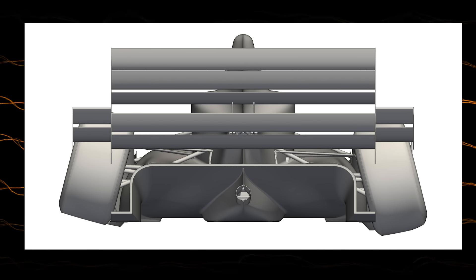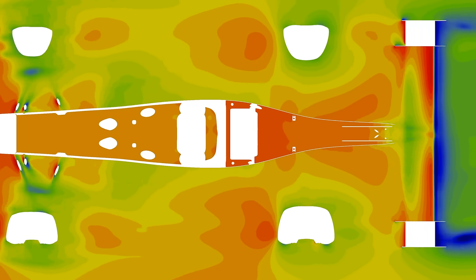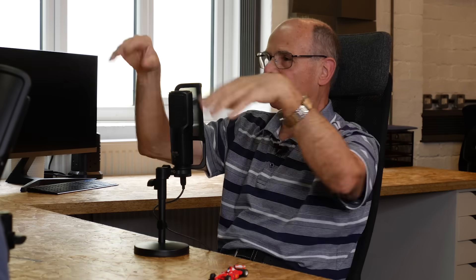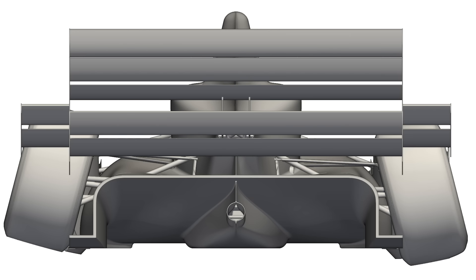Because of the significant changes in ride height, Willem decided to focus on overbody downforce — the wings — as these are less affected by ride height changes. Just look at the rear wing: five huge elements and two extra wing sections on the side. The two pieces on the outside edge of the conventional endplates see air being drawn down behind the rear wheels. You put them in the area above the wake of the wheels, where the flow is going downwards, and with a relatively low angle of attack you're turning the air a lot. The efficiency of them is much better than you might think.